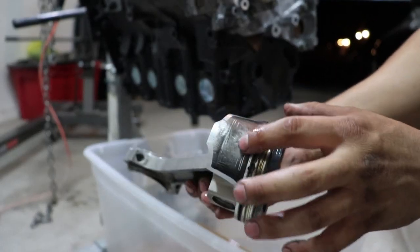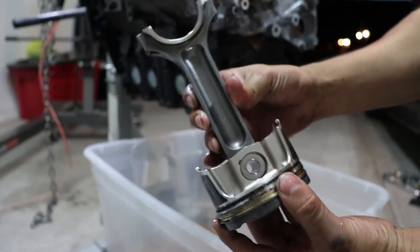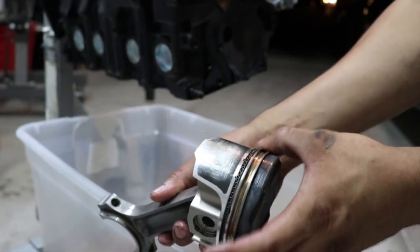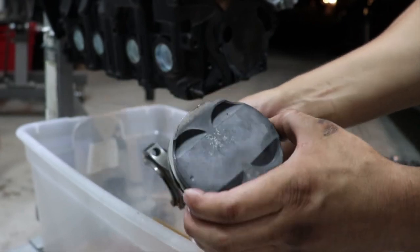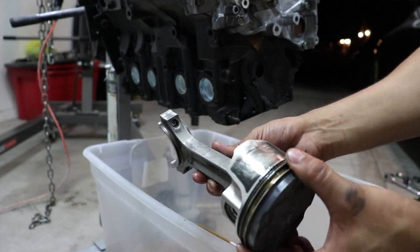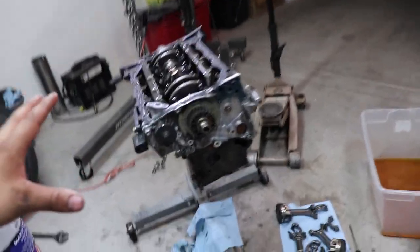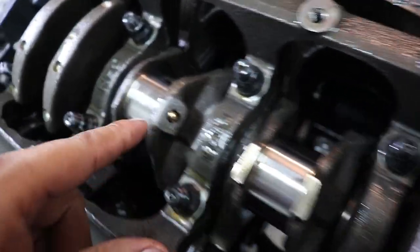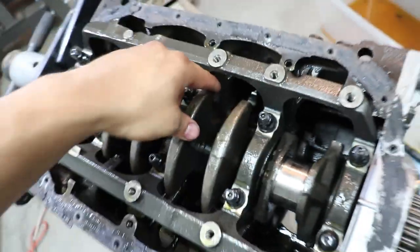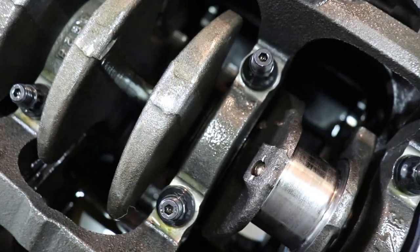The skirt on the piston doesn't look too bad — it got a little scuffed up but it's nothing too concerning. The pin itself looks like it's in good shape with no up and down movement. The top of the piston looks in decent shape — it's not cracked. I'm going to take this to my machinist and see what his opinion is. All four pistons look pretty good. The rod journals on the crank honestly look super good, it's just that one journal that's not good. The crank spins over like butter but there's a big chunk of metal in there.